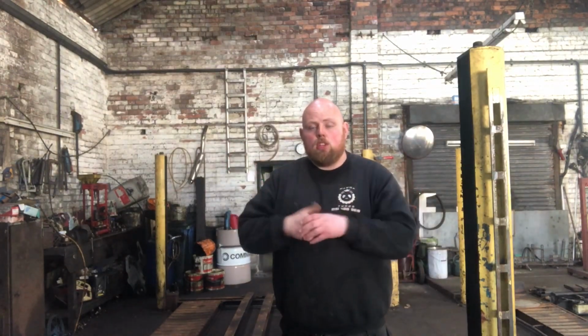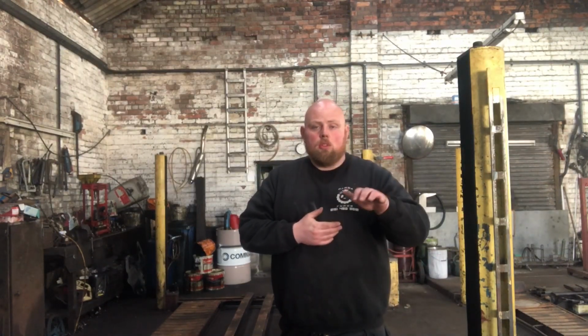After doing the wheel bearing, I've now found that when you put your foot on the brake, it pulls you to the near side. So I think the offside caliper is not working correctly. So what I'm going to do is bang two calipers on the front, and I'm also going to replace the hub, the stub, and the wheel bearing on the near side as well. So I've got fresh wheel bearings and everything on the front. And then I'll crack on with doing the sills as well.